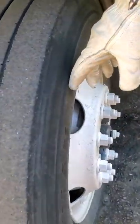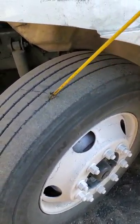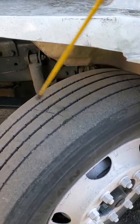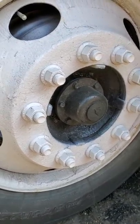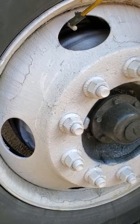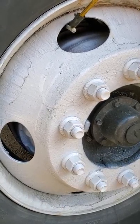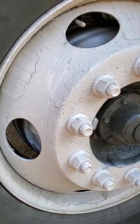Tires — inner, outer — tire walls, no abrasions, bulges, or cuts. Tires are evenly worn. There's no less than 4/32nds tread depth and there's no separation. The rim is securely mounted. It's not bent, broke, or twisted. There's no signs of illegal welds. The valve stem is securely mounted. It's not bent or cracked. It has a metal cap. I will check it with a tire gauge.